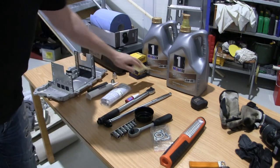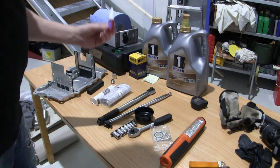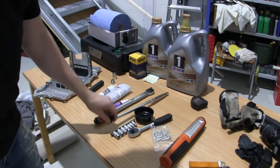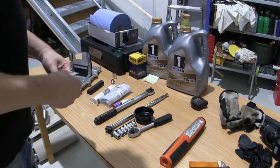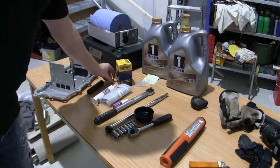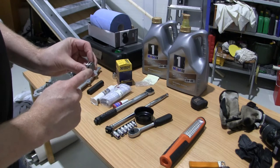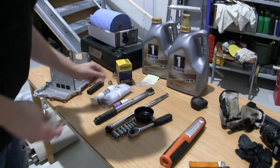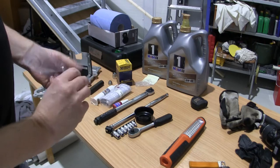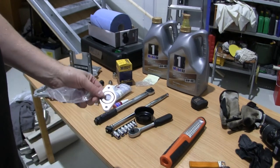So I've got some seal here to put around the edges, some Loctites for the nuts, torque wrench, and some other tools to just change the oil. New oil filter, of course, new oil. And I got a magnetic oil plug that I have reduced in height. I'm gonna show you the original one also. And then also, since the oil pan is a little bit deeper, there's a distance with the kit to lower the oil pickup. So I think it's gonna be good.